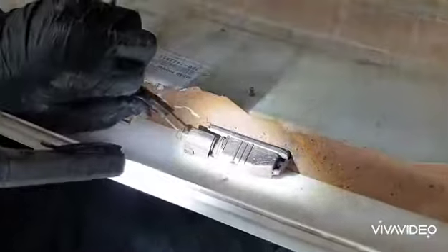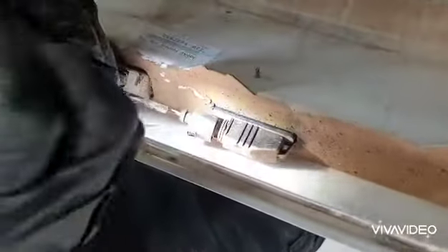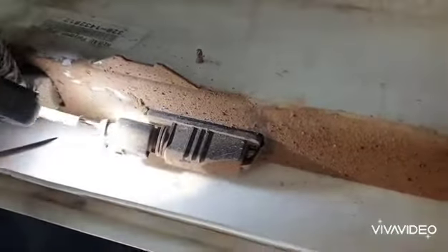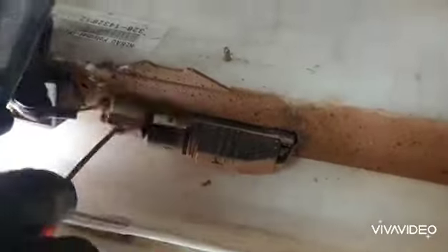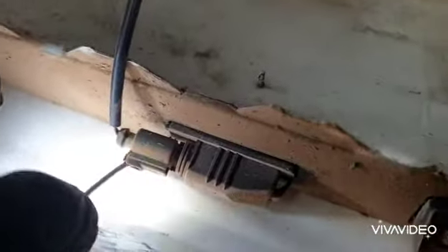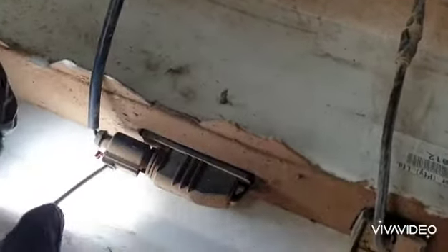Now we've got the number plate lights. Similar to the lamps, it's got this red clip that you push forward - not too much. As soon as it gets to that point in the centre, you push that down and pull it. Same again with this side: the red clip, half a centimetre to its left, push the centre clip down.